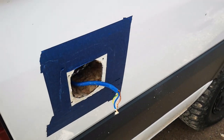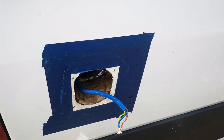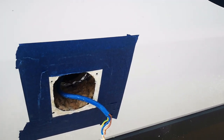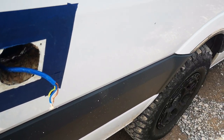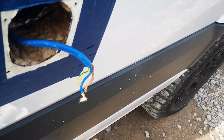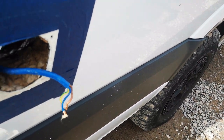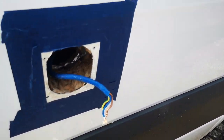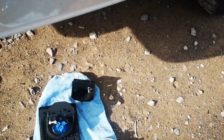I've just had to cut the hole open a little bit more, so I'm going to touch that up with some Hammerite just to stop any rust. And then when I wire it up I'm going to use ferrules this time. As I'm replacing certain electrical things I'm using ferrules, and this all dates back to my problem with my solar controller.